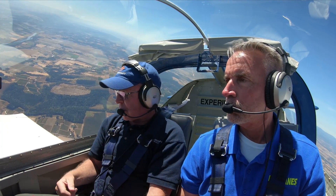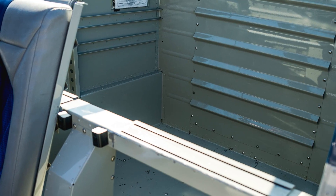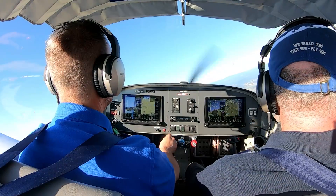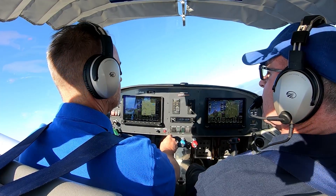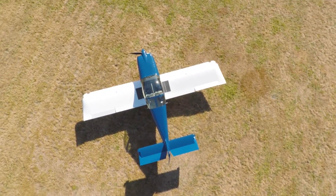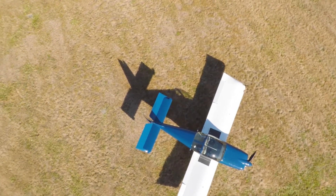We're not rubbing shoulders here — we've got room next to our elbows, certainly a lot of baggage area, general space in the cabin, and the panel's a little further away. It uses the RV10 airfoil, same wing as the RV10 but a little shorter, so a lot of parts in common. Fundamentally what people were asking for was a really good stable airplane that they could still do plus-6/minus-3 aerobatics in that would also make a great cross-country cruiser.